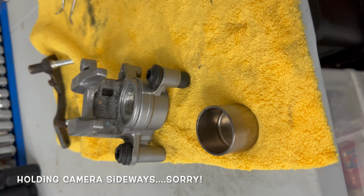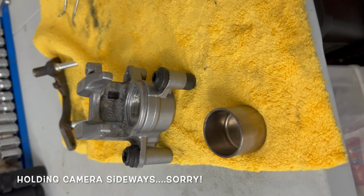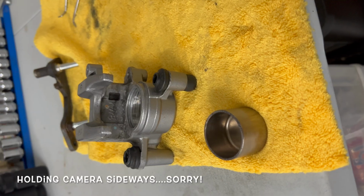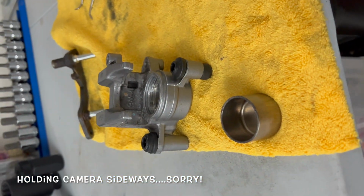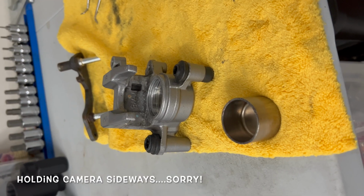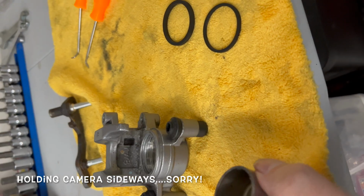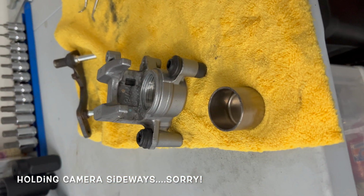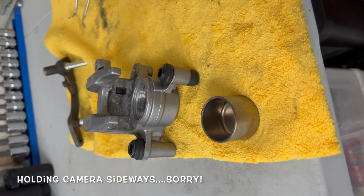And I have an 86 Helix that the front brake was all locked up, and that's a twin piston. I got that cleaned up. I spent a lot of time on it. It's time consuming, but I cleaned up the twin piston caliper on that, and it's been good for 10 years. The pistons and everything I sanded off have actually lasted 10 years with that Helix, and that hasn't crumbled back up. So it is a doable thing.